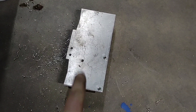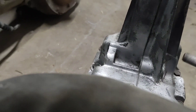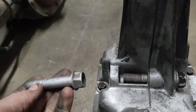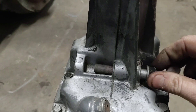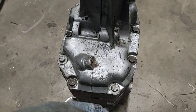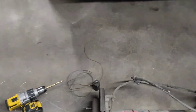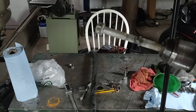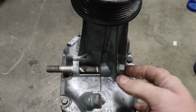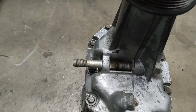The plate is almost drilled the right size there — it takes a bolt this size. I don't have the correct bolt for this thing, so to keep moving forward for today I'm going to shove this in here, cut the head of this off, and weld the rest of the bolt to the end of this. I would not trust it for longevity, but it's enough to mock this thing up. Because if I can get it bolted down good enough, I think the belt might actually fit — maybe. We'll hear it whine. That's as bad as it is. It's in — the stud's passed just enough to get the nut on it, so that's enough for testing. As long as it doesn't snap immediately, but it should hold pretty good.